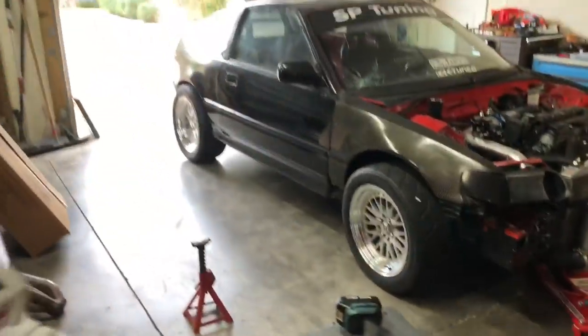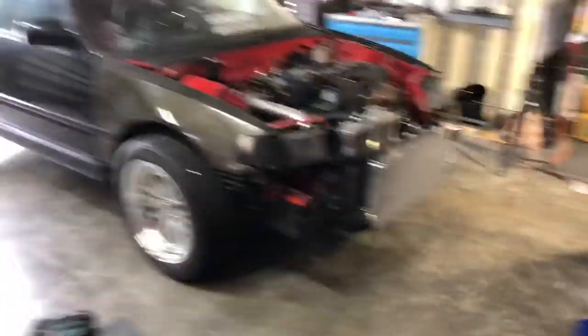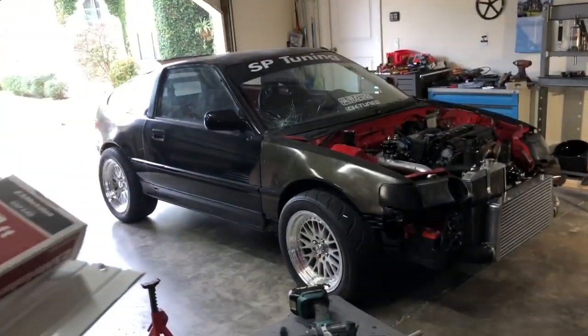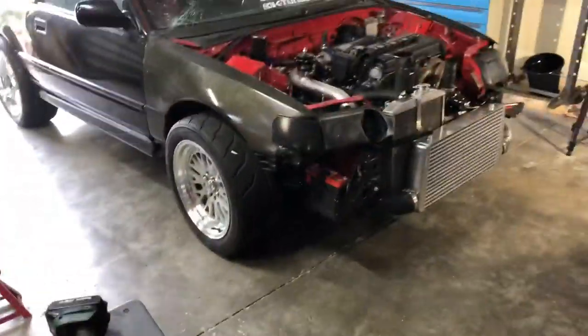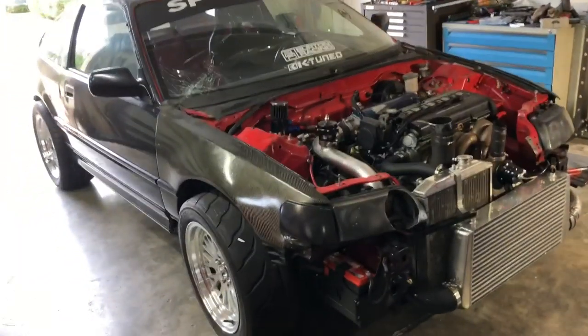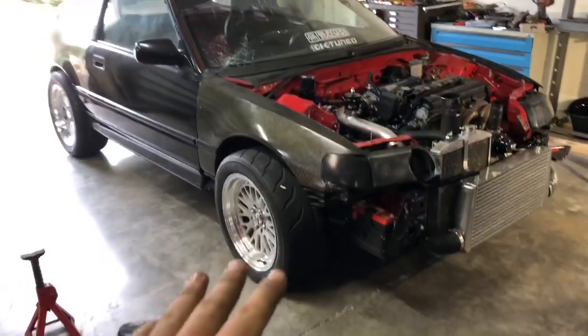She's sitting pretty with the four AV-12s, 245 all around. I haven't put the driveshaft on yet because there's grease and oil underneath from when the catch can had the wrong fitting, and I really want to get the car pressure washed before reinstalling the driveshaft. The lower control arm is on and the new modifications are on as well. The only thing left is an alignment. I want to give it a little drive first so the suspension settles, and then possibly adjust the ride height just a little lower before doing the alignment.